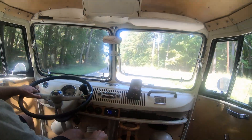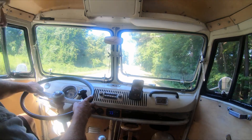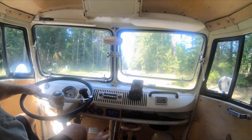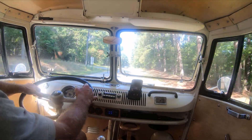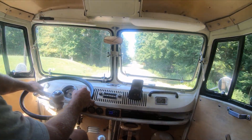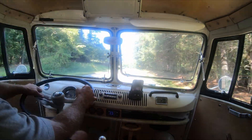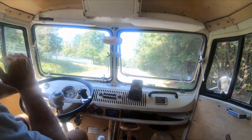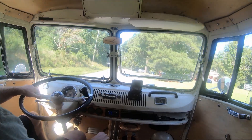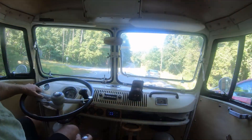It's really what I wanted — no lack of power between basically 2000 and 3000 RPM, where the noise is still low but you have good power. I haven't revved it up to 5 or 6000 RPM yet. It should do fine with the counter-weighted crankshaft, but I'm still in the break-in period. I'm going to drive it 300 miles, change the oil and filter, and then I'll feel more comfortable doing higher RPM.